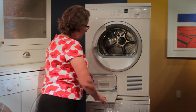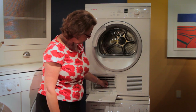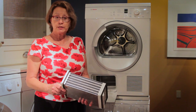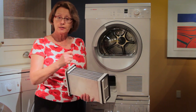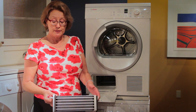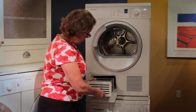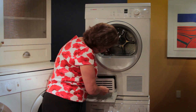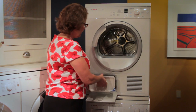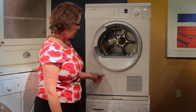Swivel the locking screws and gently remove the cover, then pull the handle of the air cooler to remove it. Take it to the kitchen sink and run it under cold water using the spray arm so the water goes through all the different levels and removes any sediment — do both sides. Don't use any sharp objects; just use water. When finished, carefully slide it back into the compartment with the handle in the lower position, replace the cover, push the screws back into the lock position, and close the maintenance flap.